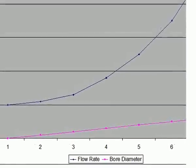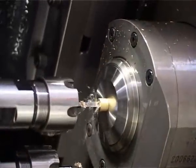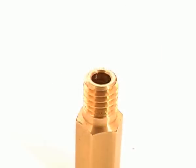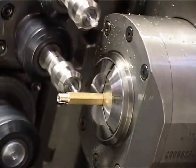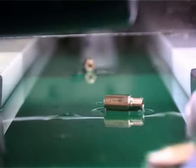That's why the bore diameter is so critical, and that's why EBC takes so much care to get their jets right. EBC carburetor jets are made solely in the UK on state-of-the-art automated machinery. Regular batch inspections are also made by hand after manufacture with super accurate pin gauges to a tolerance of 5 thousandths of a millimeter, and thread accuracy is checked on every batch using a go and no-go gauge. This meticulous manufacturing and checking process ensures every single jet in every single batch is correctly machined and marked as one process, ensuring complete accuracy in jet size markings. Some other manufacturers mark their jets at a later stage in the manufacturing process, which makes slip-ups all too common.